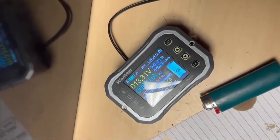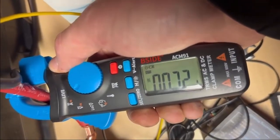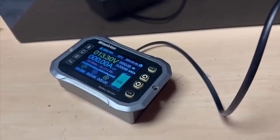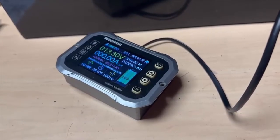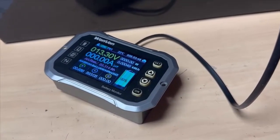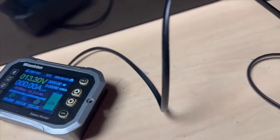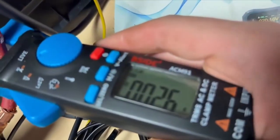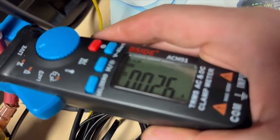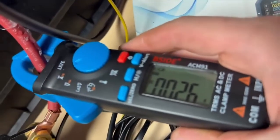It has now been a little over four hours and we are down to 0.07 amps of current — almost nothing. At the five-hour mark we're not getting any discernible current from the monitor. Every once in a while it jumps to 0.1 but immediately falls back to 0.0, sitting at 13.3V. The clamp meter reads 0.026 amps — so at this rate it would draw one amp every 40 hours, and it has been getting progressively slower.